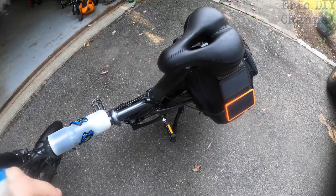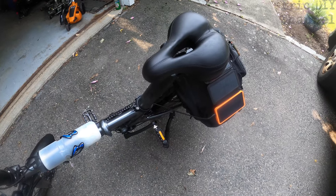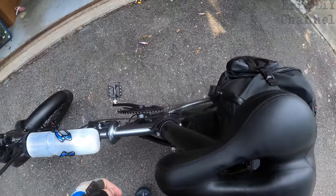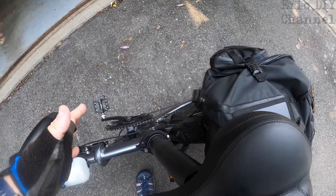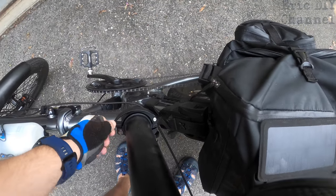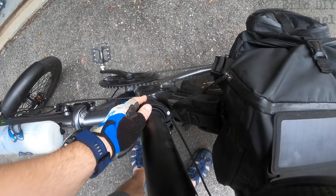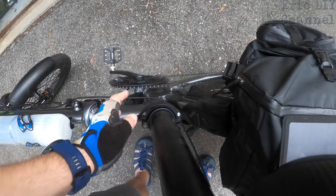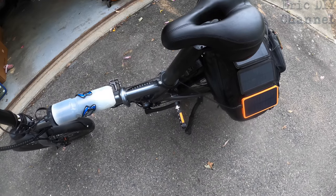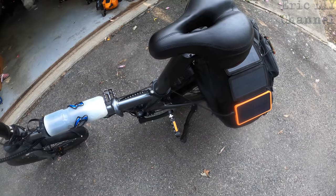I already like this locking bike clamp a lot better than the original one that came with the Quali Sports Dolphin. To conclude this review: I did about four more rides and finally got it to where it's totally locking down really tight. The trick is that you have to tighten it far enough, and make sure that when you're clamping this down there is just a little resistance when you push it in — that means it's really clamping against the battery seat well. It worked perfectly today: about 12 miles non-stop, no slipping at all. It's perfect now — just takes a little adjustment.